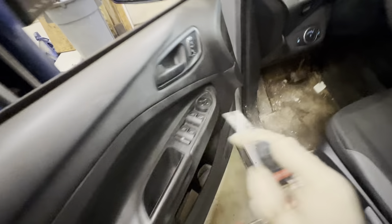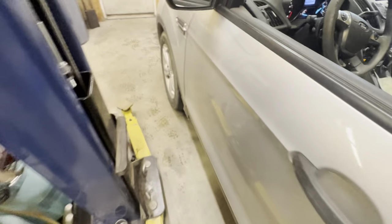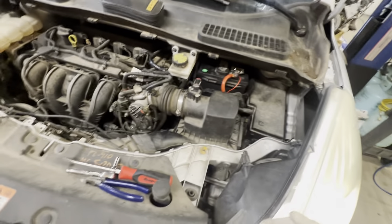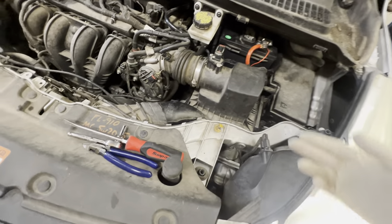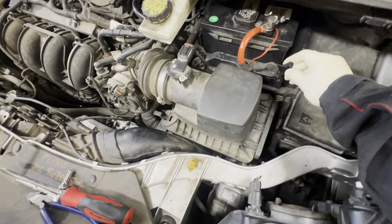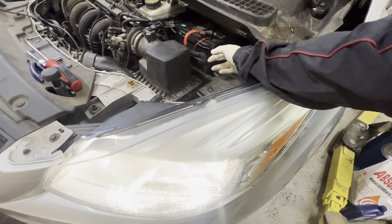It's clearly running. Customer came in saying that when they hit a bump, or sometimes just driving down the road, the vehicle will die. He actually found out that if you wiggle the wire here it would sometimes make it do it. I looked around and if you wiggle it right here it'll actually almost die — you can watch the headlight. I'm just pulling on that.